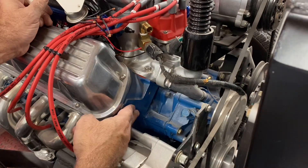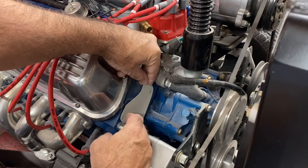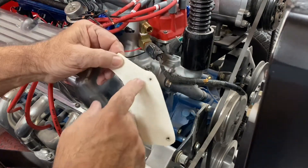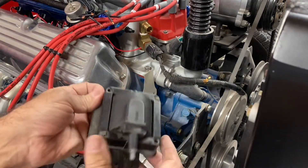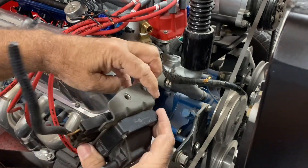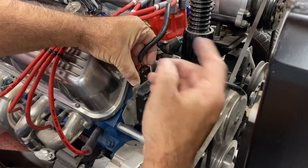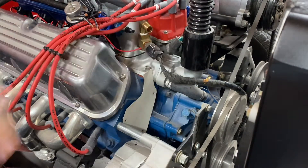I need to make a steel mounting plate to go on the front of the cylinder head to mount my coil. I'm making a paper template first — I cut a rough outline of the outside of it and used a rounded punch to rub over where the bolt holes are, making an impression on the construction paper to pick up my hole centers. What I'm going to do is take this original Mustang coil mount, cut this leg down, add another piece, and weld it all together. It should mount somewhere around there, clearing the heater hoses, alternator, and everything else.